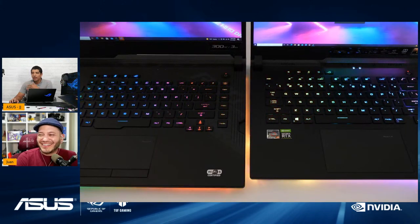So if you look between the two here, you can see the standard keyboard that you could still get on some of the 2021 models that don't, of course, come included, like let's say the standard G15 as opposed to the SCAR. But the SCAR on the other side has the optical mechanical keyboard. Yeah, looking real good. And personally for me, I find that, like I said, they're not super loud, but they are noticeable, right? So you can experience it. Travel is going to be very similar. 1.9 millimeters travel versus I think the standard is 2 millimeters, but they both still feature that overstroke technology. And I think I can actually show you guys a slide here. So let me show you a closer look in terms of this.